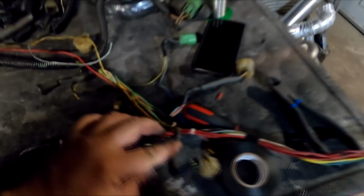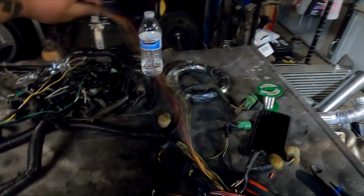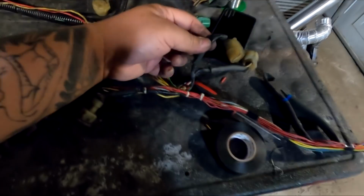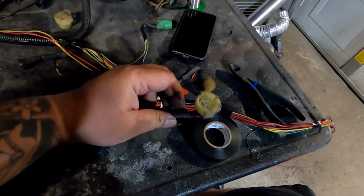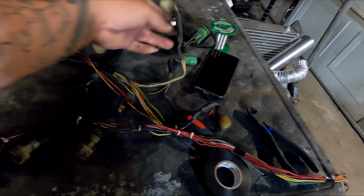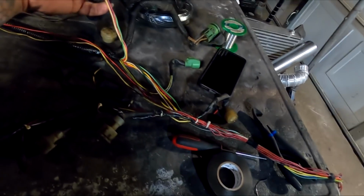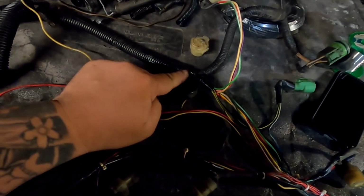That side is done. So moving on to this junction again, we have the 2 other injectors that we need to wire into the plug right here. But before we get to this, because we're at this junction right now, IAT sensor in place. The TPS sensor is not going to be sitting in this location anymore, and we're going to have to move the TPS 3 wire. We're going to have to splice it through and probably put it right at this junction.